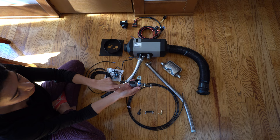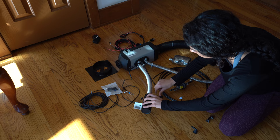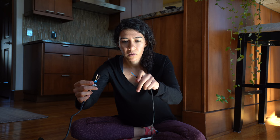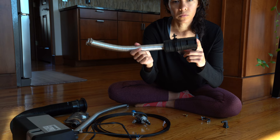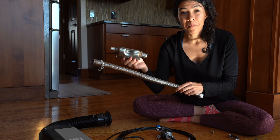On the fuel pump you'll see a connector that allows you to connect back into the Webasto for the electrical. You grab this cable — on one end there's a plastic hook that pops right in, on the other end your positive and negative wires connect and take you into the Webasto. On this side is your intake — we opted for the silencer kit, so this end is a little longer than standard. And our exhaust — we bought a muffler, which is equivalent to a silencer for the exhaust.